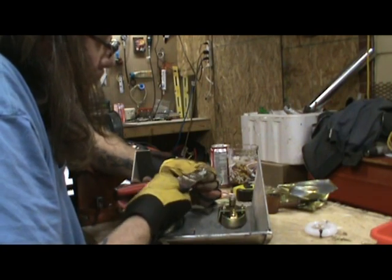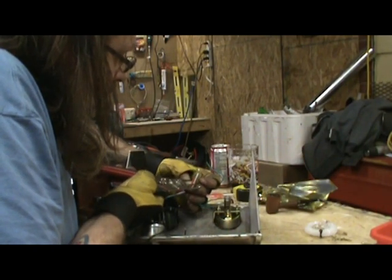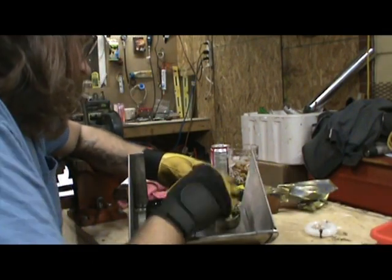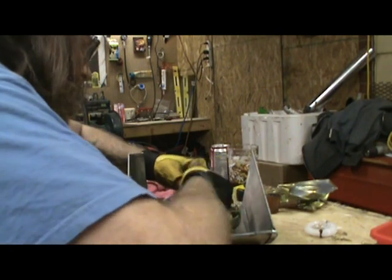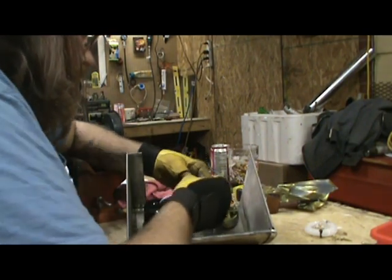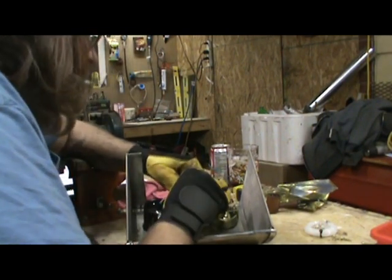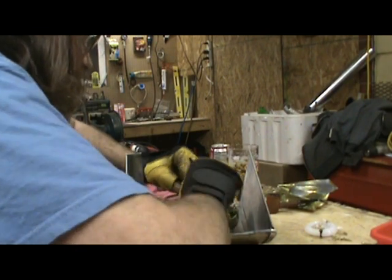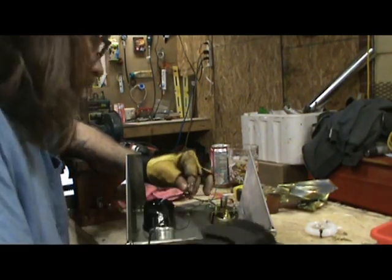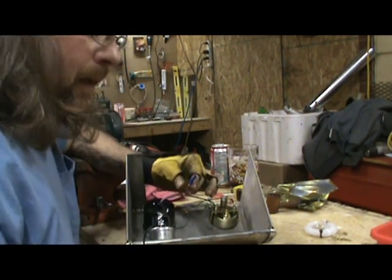This is my hot wire for my light in the tach. I definitely want to go ahead and hook the lights up in it. Now let's twist them all together. Just a little bit more wire there. I'm just going to trim this off a little bit there and put my connector on it. I'm ready to crimp that bad boy.